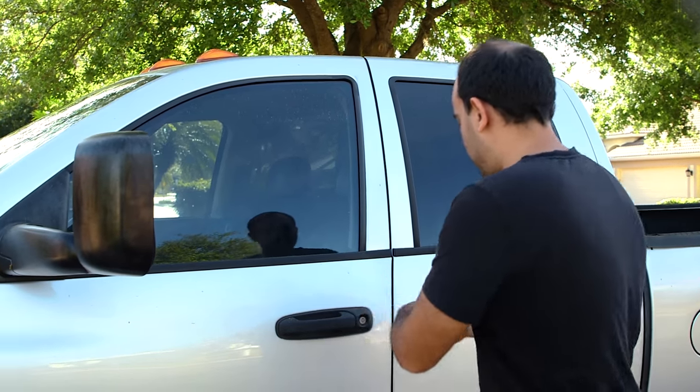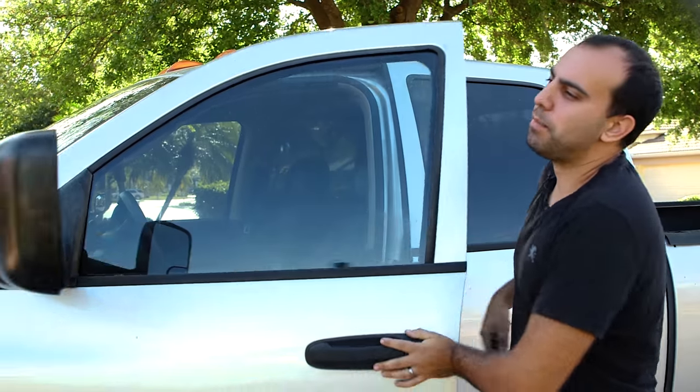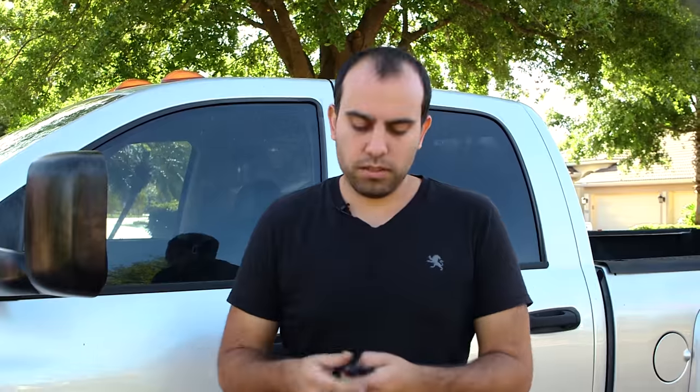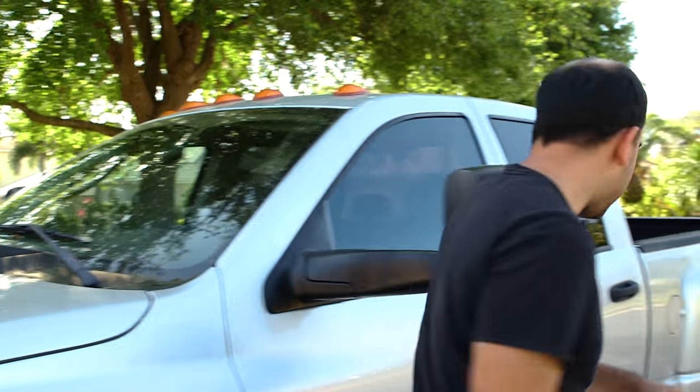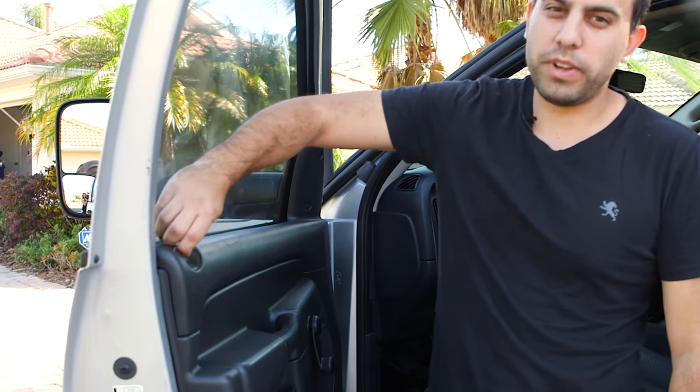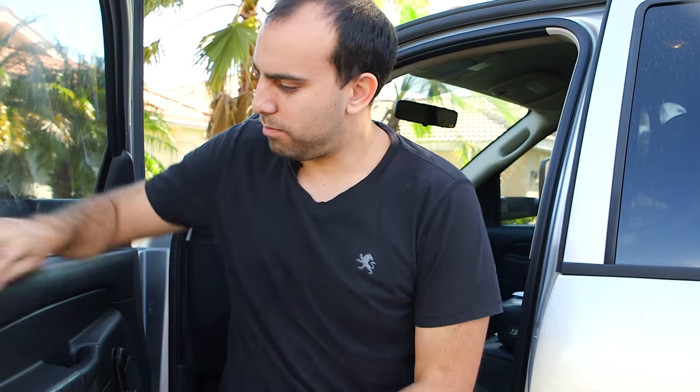So excited to have this done, especially with a kid. It was very difficult — if we were loading Hudson on the other side, you'd have to come here, unlock this one, reach over, unlock the passenger door, walk around to the passenger door, open that one, reach to the back, unlock the back, put him in, close the door. And when you get somewhere you don't even lock the truck because locking all four was annoying. So it's done, it works awesome. I did take the time to hook up the parking lights so when you lock and unlock it flashes the lights. My switch is also working great. You can lock with the key fob, or lock and unlock with the driver door handle, or press the switch. Hope you guys enjoyed. See you in the next one. Bye.